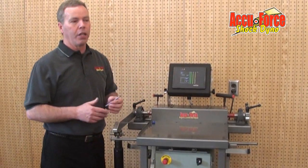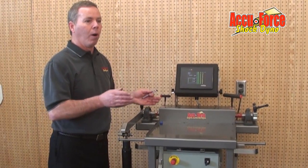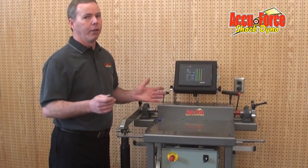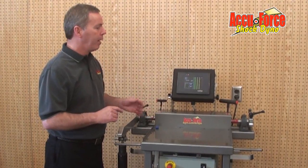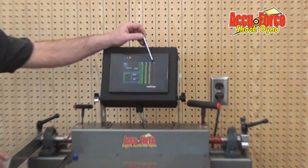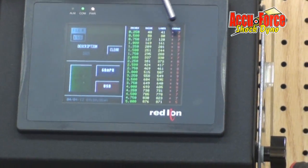And that's one thing, you're going to have to test a lot of different bars to get a feel for what different bars do. They all have different characteristics. That doesn't mean they're good or bad. You're going to have to determine between your race car and what you see on here what's good and bad. The one thing I can tell you is, if this split gets up into the teens, especially at the early numbers, you probably got a bar that's getting weak.